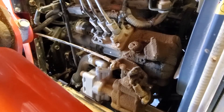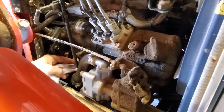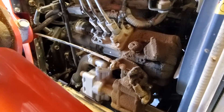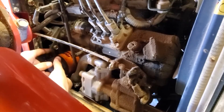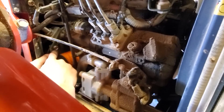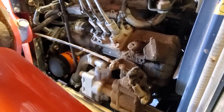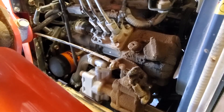Now the old oil filter is off. Because this is a tractor, I want to go around the face plate of the oil filter mount and gently clean all the oil off of the engine surface. The reason why is because this is a tractor and it's full of dirt — all around the outside is dirty, and you want to make sure you don't get any of that dirt into the engine. Then bring your filter up into place and screw it on until it stops, and then lightly snug it up and go one quarter turn past where you stopped. If you over crank the filter, you will push the oil seal out and it'll leak. Oil filter's on, drain plug's on — now we just have to fill it and put that cover back on.